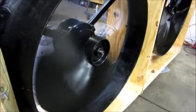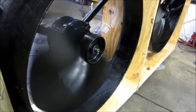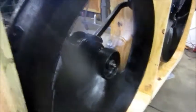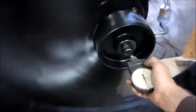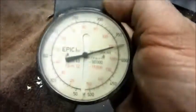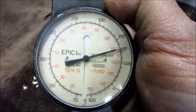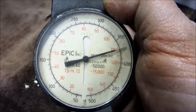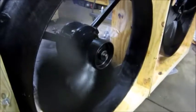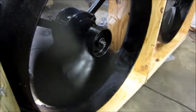Okay, somehow we just got teleported to England — so now we're running at 50 hertz. I'm sure you heard a distinct change in the sound. We're running about 320 to 330 RPM at 50 hertz. You really lose a lot if you took one of these fans to a 50 hertz country — you really need to have a motor with a different winding in it.